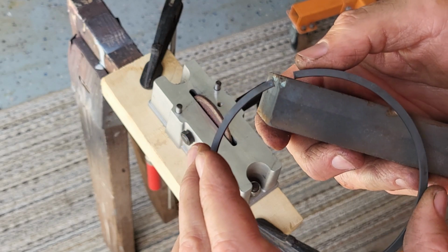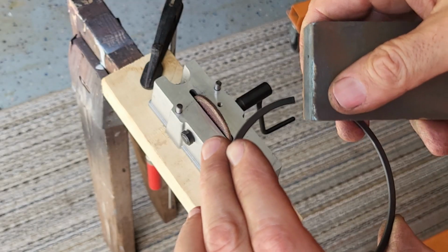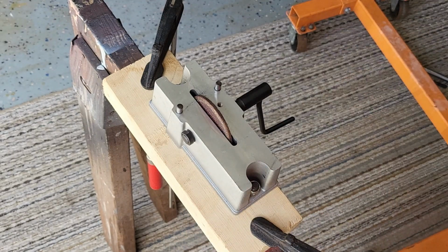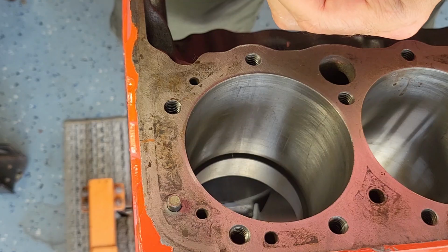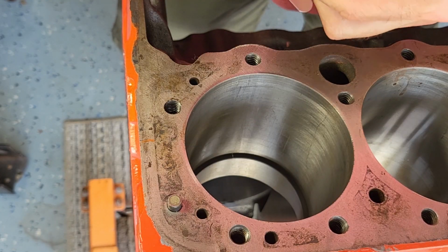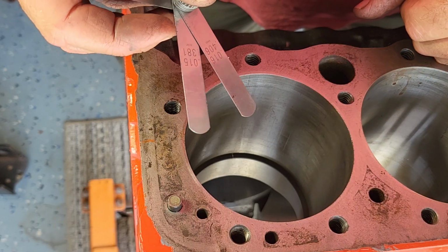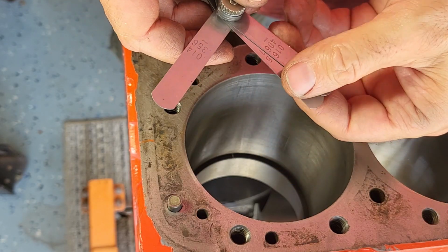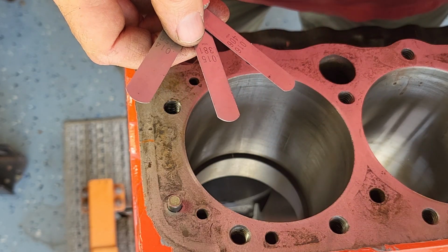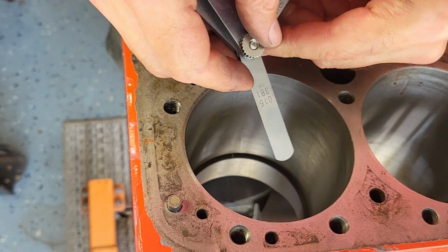Without damaging anything else. And then, okay, now I'm going to stick it back down to the hole and get a measurement out of it. So this is after the initial grind, and my target gap down in the hole, all the way down 3 3/4 inches, is 16. So I'm going to start with the 14, 15, and 16. And remember, I didn't go the entire 50 turns. I only went 40. So let's see what happens.